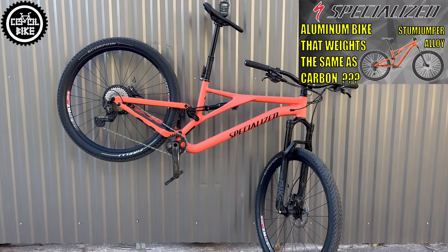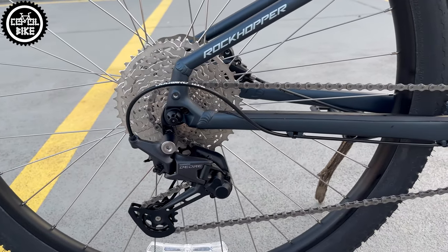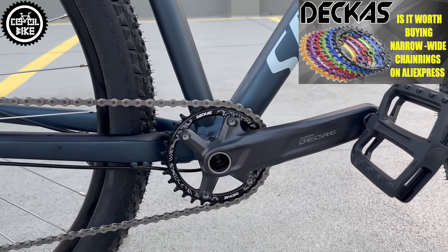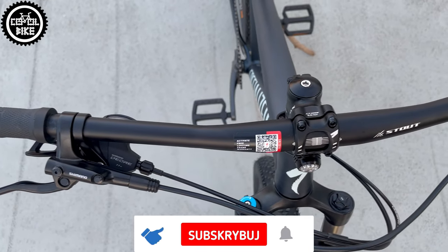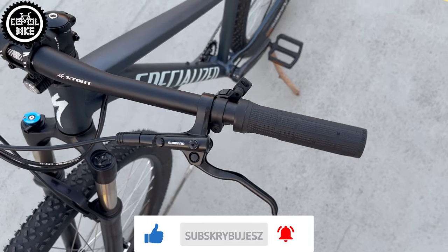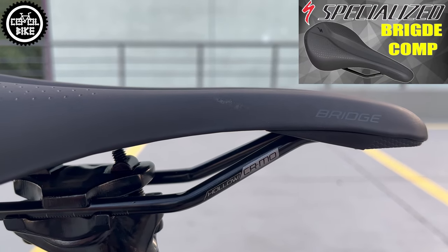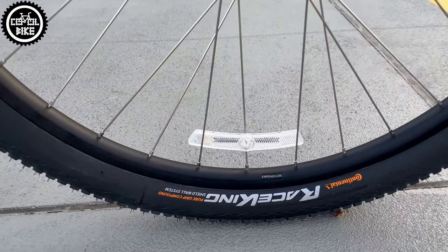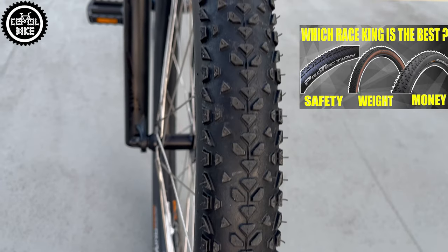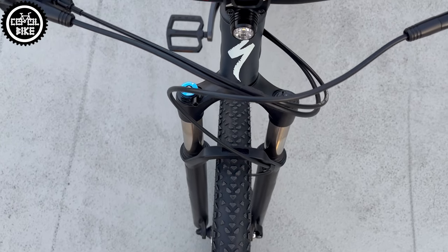But in a moment I will show you how to change it without paying more than 1000€ as for the Expert version. The first thing I wanted to change was the drivetrain — I replaced it with a durable Shimano Deore 1x11 with XT chain and a lightweight chainring. I swapped the brakes for basic but easy-to-set-and-service Shimano MT200. I replaced the saddle with the same model but in a lighter version with hollow chromoly rails. Tires were swapped for super fast and puncture-resistant Continental Race King ShieldWall.